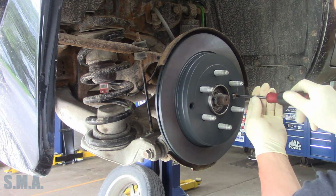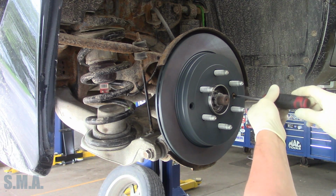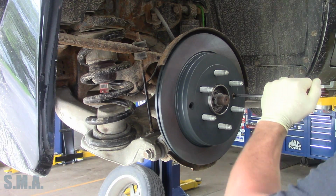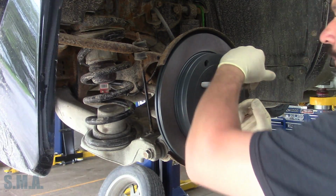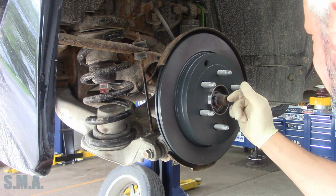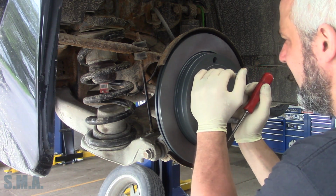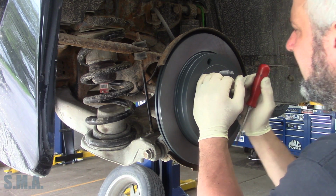Why didn't I already have the brakes together on the other side? That's a great question. Glad you asked. So if I take something apart and the rotors come off wicked hard, usually what I'll do is I'll pull both sides, because if the parking brake shoes are shot, then I got to do both sides anyways, if that makes sense to you. And only having had that side over there apart, I didn't know what was going on over here.